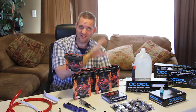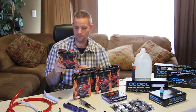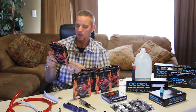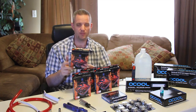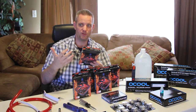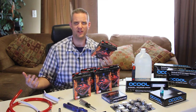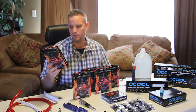I can't wait to see how these sound because they're advertising only 22.5 decibels at 100 cm sound pressure. So 22.5 decibels. We're going to see if that's 22.5 at 6 volts or 12 volts. Some companies will only show you their sound rating based on their lowest starting voltage, which is kind of unfair because you put 12 volts to it and then it sounds like a hairdryer. And then you get it and you're going, well, I thought I was getting a quiet fan, and now I've got this really loud hairdryer in my computer.